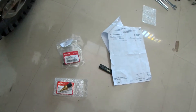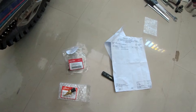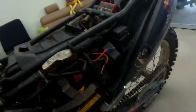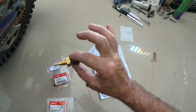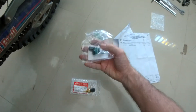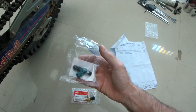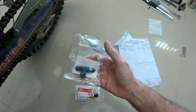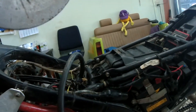What's up, people of YouTube! We're back on to the little donkey. Little donkey died on me the other day and it could be terminal, but I've managed to find out how to read the ECU. The ECU threw up two code numbers which I deciphered as engine temperature switch and unfortunately the fuel injector. I did have the injector out, laid it on the cylinder head, cycled the pump a few times, and the spray pattern looked really heavy — not very good at all. I'm not going to doubt what Honda's logged in the ECU.